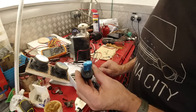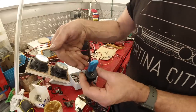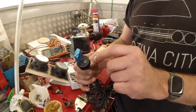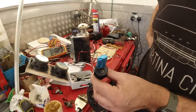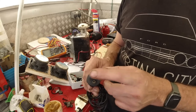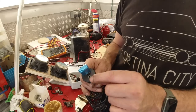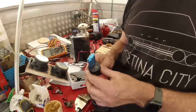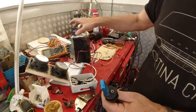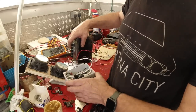Obviously we don't want to damage the car, so either make a plate or put it in the glove box - maybe on a little down-folding bracket. That's the USB. On my car recently when we did this, this lead stopped the player from recognizing the stick - I don't know why it works direct into the module but not on the lead. This one's working though, and it also has the line-in connector which connects up to the line-in adapter, and you can call the line-in up by pressing the mode switch.